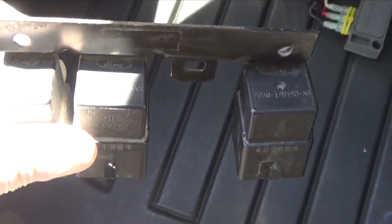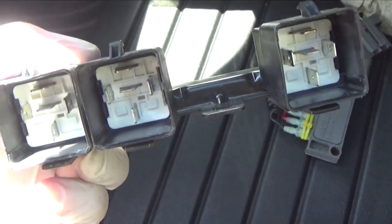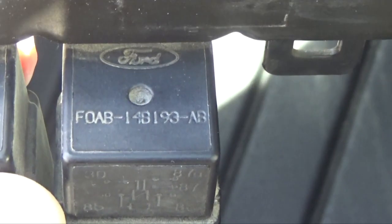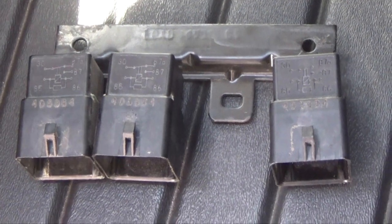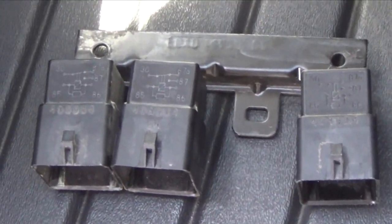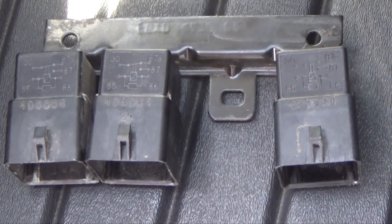We are going to change all three relays next to the battery, hiding behind the headlight. There are these three relays. They're original Ford. This truck has, give or take, 26, 27 years. Yes, we're going to change that. All right, and we're also going to change the crank position sensor, which is inside the distributor, but instead we're going to put a new complete distributor on it.